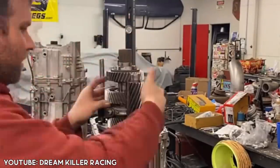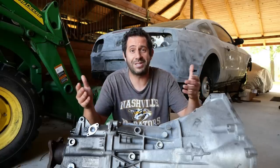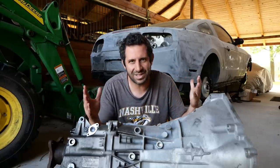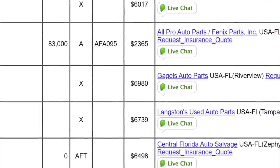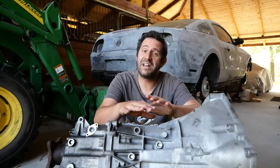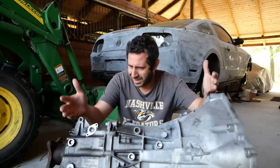To figure all that out we've got to crack this case open, which requires some really specialty tools like long jaw pullers that I just don't have. On top of that, figuring out what's wrong could lead to a major time constraint. The second solution - the quickest one - is to grab a gearbox out of the junkyard, but that isn't smart because of the documented plastic component issues. And every junkyard transmission I found cost more than a remanufactured transmission, which is our third option - the one I went with. I paid two thousand dollars for a remanufactured transmission that comes with a warranty and has all plastic components replaced with metal ones, and I got it within about a week of ordering it.